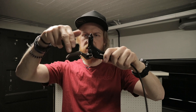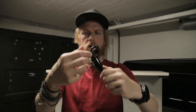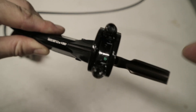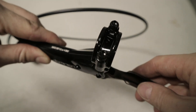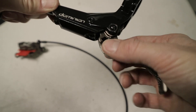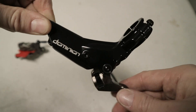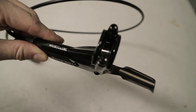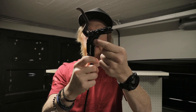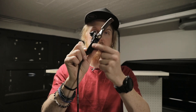The lever is a nice size — it's a two-finger lever that opens fully, so it's easy to install. There's a very handy reach adjustment system so it's quick to change. It has a nice grip surface and you have your bleed port over there and a bleed port underneath, so it doesn't matter which way you run your brakes — you can still bleed them easily. There's also an expansion chamber over here.